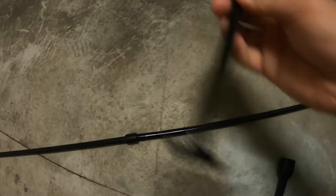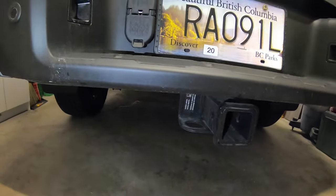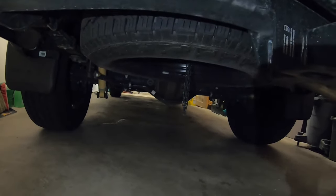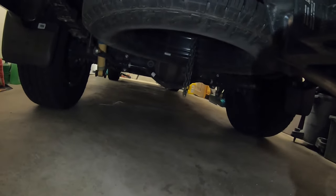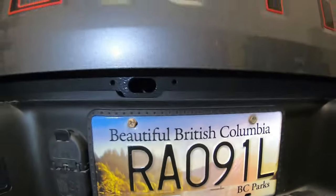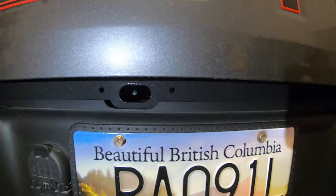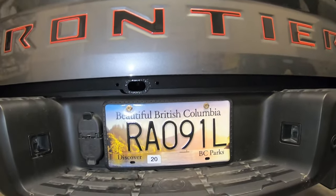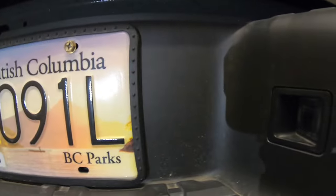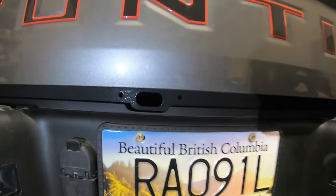Your final one with the T is the top. For demonstration purposes I'm not gonna take this tire right off because that's just too much of a pain in the garage — I just want to show you how it works. If you can see the chain hanging down, it shouldn't be like that; it should be on top of the wheel, so we'll fix that. If you come up underneath your tailgate, just a little left of center, you have a hole there. This is where it is on the Frontier. If you have a different truck, sometimes it's behind a little latch cover. You open it up and it's just a hole to crank the spare down.